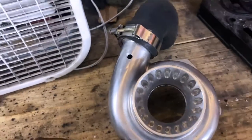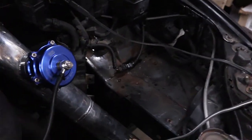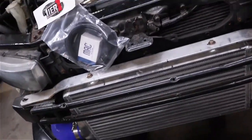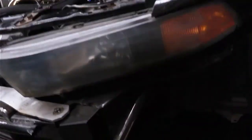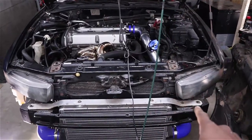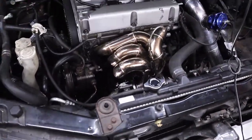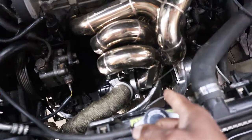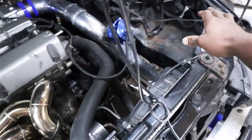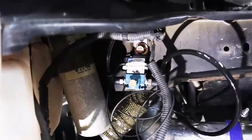Getting this back on the car and then we'll be ready for some boost control. I was going to install it in this corner over here, but I may even go a different route — maybe put it over here on the side. Alright, I changed it up a little bit: instead of mounting it over here I'm actually mounting it over here. The reason being is just because of where the connections are — the wastegate and the pressure source coming off the turbo are all on this side, so plumbing it to the other side would require a lot more hose.